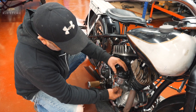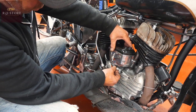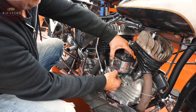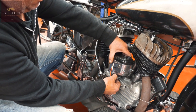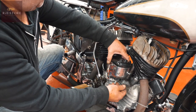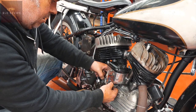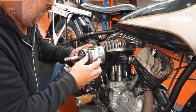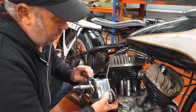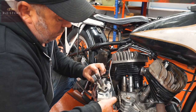I've got to make something to hold that in there — a bolt up through there, a pin up through there, washer on top, probably with a slot in it, spring-loaded so the magneto can't jump out, but it's got to allow movement for your advance and retard. I don't quite know how I'm going to make that yet because you've got to be able to get around to the back. I couldn't find any pictures of this style of magneto. It's also got a rev counter drive coming off the back of it.